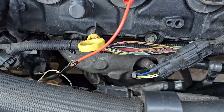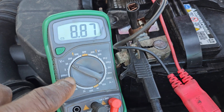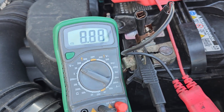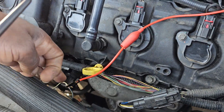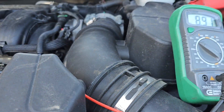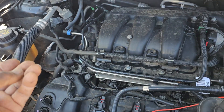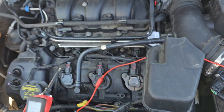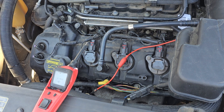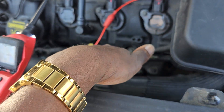Even with the noise, the fans work because I put the AC on. I'm going to stop the AC and stop the engine and let's see what happens. The lower the voltage goes, the faster the fan will work. Be sure that you have continuity between the wire coming from the engine computer. The engine computer is located under the hood in different spots depending on the car. The command comes from the AC pressure line, transmission temperature sensor, engine coolant temperature sensor — the signals go into the computer, and the computer interprets them and sends a signal based on what is needed.